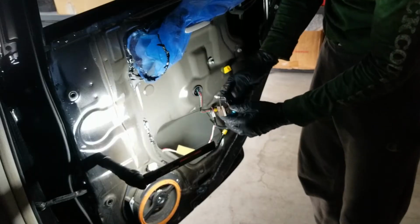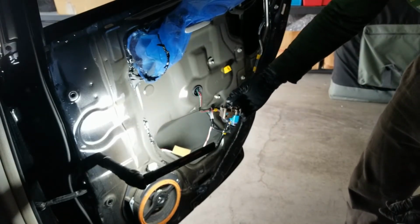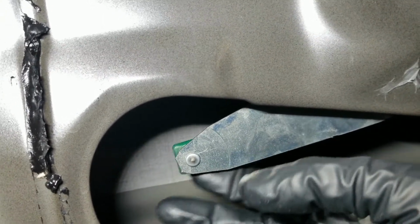And two. And we can lower. If you recall, that green bit, there she is. So this window, this glass is actually now just hanging in there by friction. Reach our hand under there and see if we can manipulate this glass. Sometimes the friction in there is not so great and that thing will want to drop down, so be careful now.